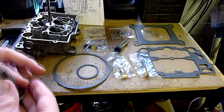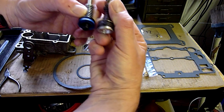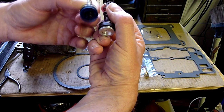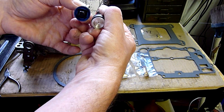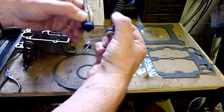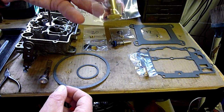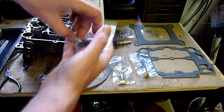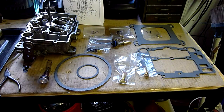All right, here's the kit out of the bag — I just wanted to show you what comes in it. My main thing is the accelerator pump; this is the original. Definitely different. We test-fit this pump in this carburetor at the shop and it seats fine. The design difference is interesting — we'll see how it performs when it's one day on the car. You get your sets of needle and seats, all your little mini gaskets, your base gasket, your air horn gasket, your air cleaner gasket. That's really it.